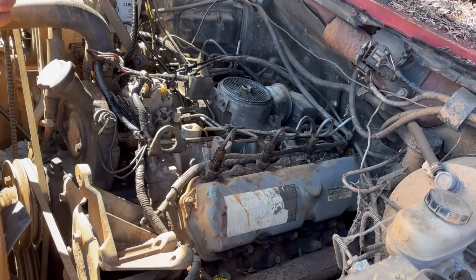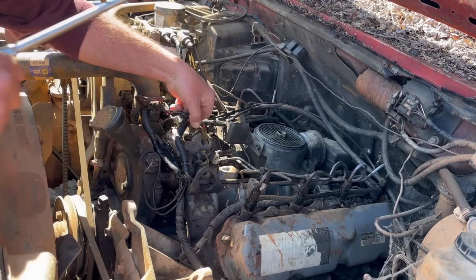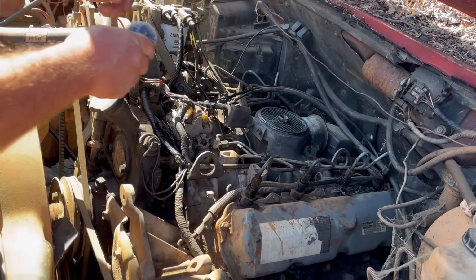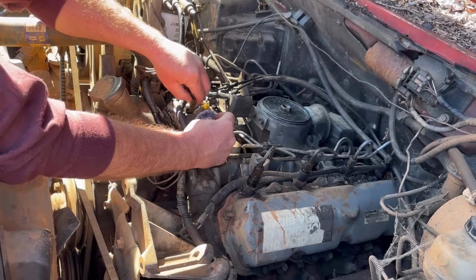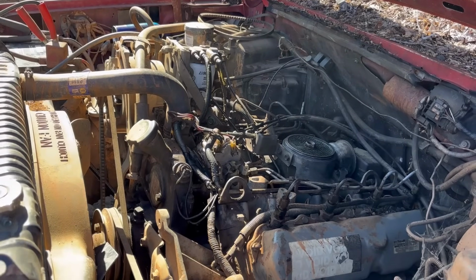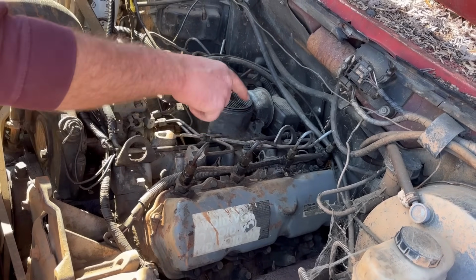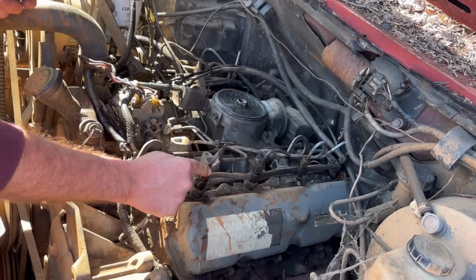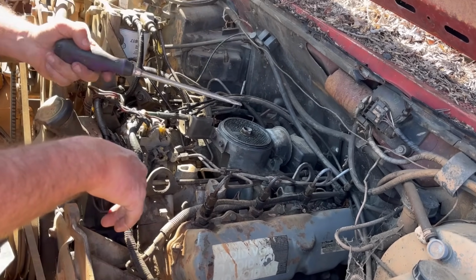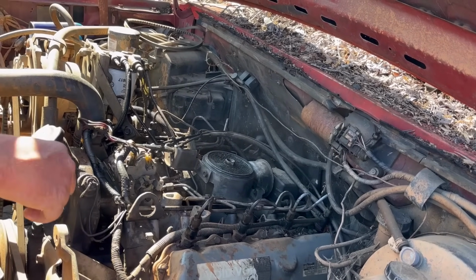All right, switch is on, right? Yeah. Let's make sure we hear this thing click. Yep. I'm actually going to hold y'all up there so you can hear it. So now we got a lot deeper click inside that pump. So at this point, if I keep spinning, it started squirting out of that injector line right there first. These four are the ones I've got broke loose. These four over here are still tight. So I'm going to turn the engine over until I hopefully see fuel coming from all of them.